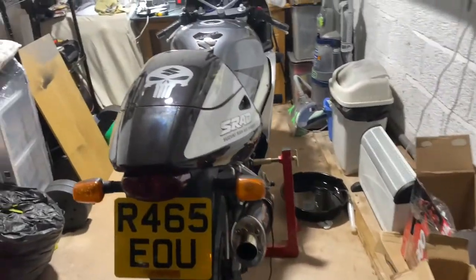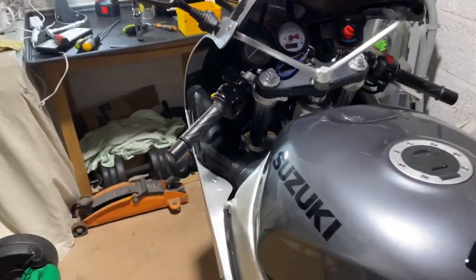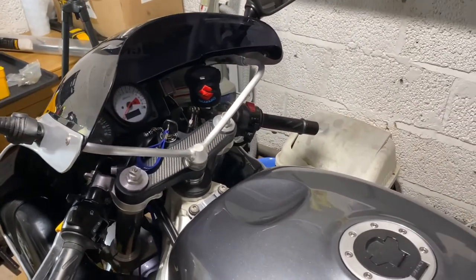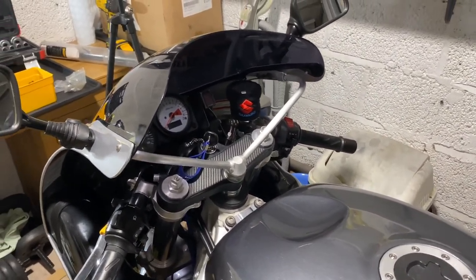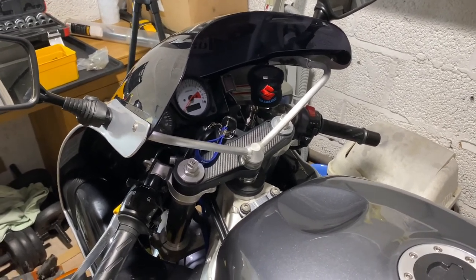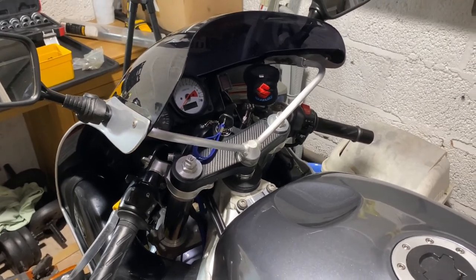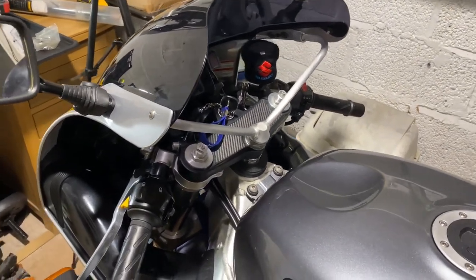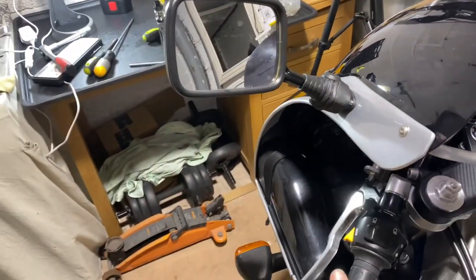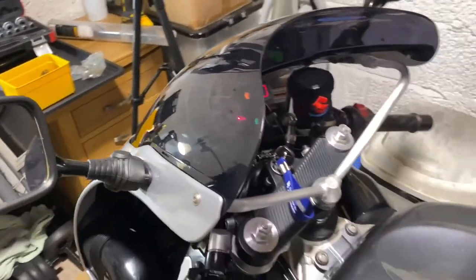One thing I meant to say on the videos, I don't know if I did say it actually, because it's been a while ago. The fuel air mixture screw that's usually sealed, it's usually plugged when it's a brand new bike. But if it's been dynojetted, it'd have been drilled out. Well, on the dynojet website, it tells you to turn it out to 2.5. Well, I tried it at 2.5, and to me, it was running too rich. So I've tried it now. Well, this is it now. This is me trying it at 2.25.